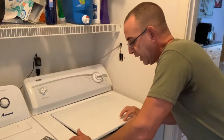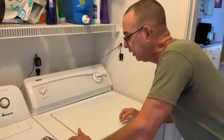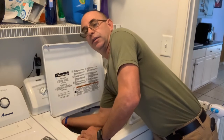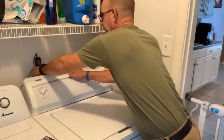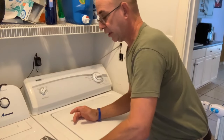When I went down, I wasn't really hearing it click much. And I'm like, that should click. So where is this all at? I moved the drum over, and I reached up in there and I can feel it. It goes behind up here. So I need to get to here. How do you get to here? All right, unplug it right here. Always unplug it first, right?